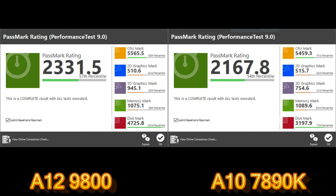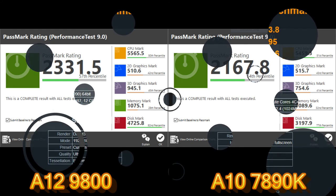An interesting thing is the memory mark scores. The A12 system is using 2400 MHz DDR4, verified in BIOS and software, with only 512 MB dedicated to the graphics cores. The A10-7890K system is using lower-speed 1866 MHz DDR3 with 1 GB dedicated to the graphics cores. Yet the memory score is actually very slightly higher on the DDR3 system. Both use MSI motherboards and Corsair RAM, making them about as close to identical systems across two generations as you can get, which makes that memory result strange.